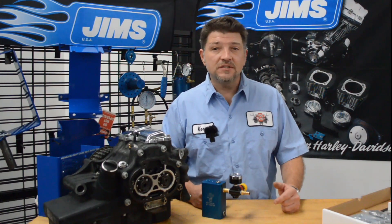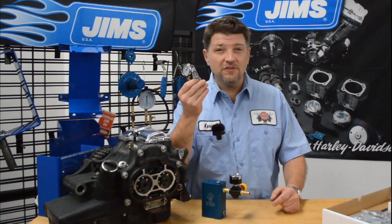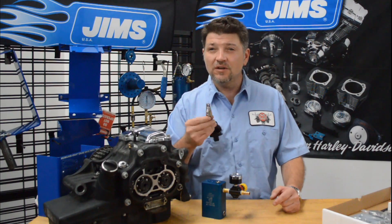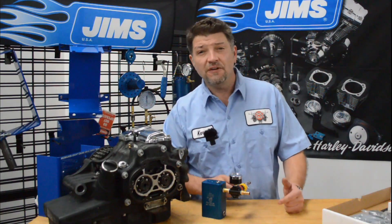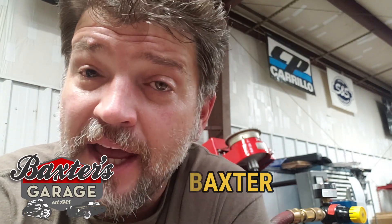If you haven't seen our M8 engine teardown videos for Stephen, after this video I would strongly encourage you to watch those, because this one little piston oiler was the cause of what became a severe sumping issue and led to his engine failure. We tore down an M8 and determined that it had a bad piston oiler assembly, and that's what led to the sumping issue. Twin cam owners, you had that issue too and may not have even known it. So today we're just going to take a couple of minutes and I'm going to show you why we test piston oilers with the Gem piston jet tester on every Skunk Series engine we build.